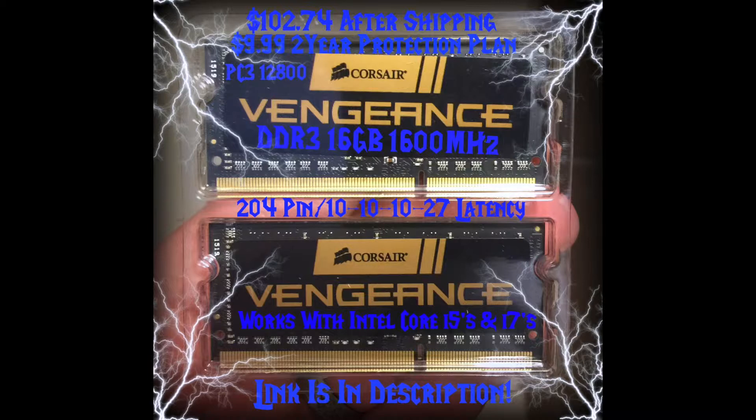This also works with the Intel Core i5s and i7, and I'll put a link in the description of where I bought these. I do plan on buying another set just like this, removing my 4GB — the two sticks of 2GB I have in there — and replacing them with two more 8GB sticks, giving me a total of 32GB of RAM. I do a lot of video and picture editing and I don't want that to be the issue with my slowdown. It's about the only thing I can do with my 27-inch iMac when upgrading, other than popping the top off and replacing the optical drive with an SSD, which I might do later down the road.